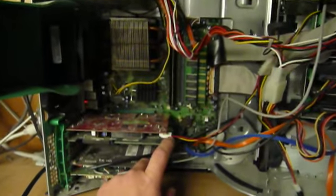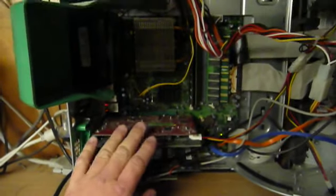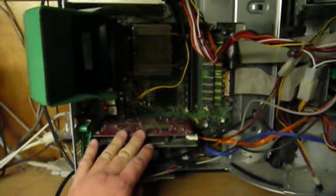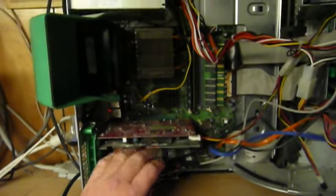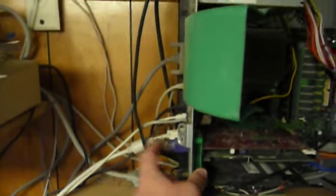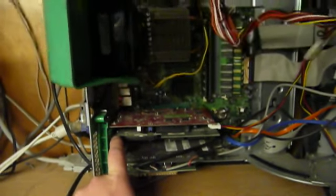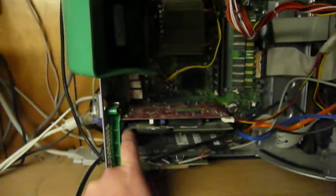It pulls a lot more power than the NVIDIA did, and has a dedicated power connection coming to it. But it was about the cheapest thing they had. It was on sale, and it's a very nice little card. It has dual display support, and I have two displays hooked up to it: a ViewSonic 19-inch CRT and a Gateway 19-inch flat panel with a DVI-only connection. The Adaptec 2940, a SCSI adapter, I have actually used that for a number of things.